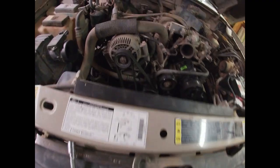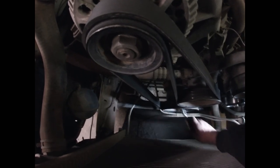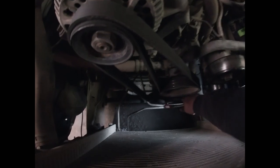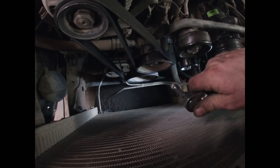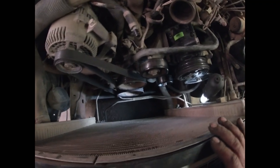So what this does is it works kind of like a strap wrench. As I turn these bolts — I've got a couple that are still pretty tight — I thought this was all just going to come apart real easy and be quick and dirty, but as I turn, the belt doesn't turn because the rubber is gripping onto the belt, lapped up over itself, which keeps that belt tight on the pulley. And then of course it's anchored to the water pump pulley. Hopefully you guys learn a little trick here to help you in some of your pulley-removing endeavors.